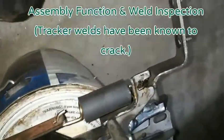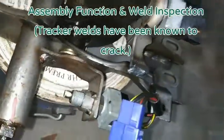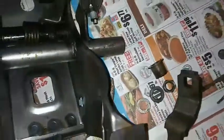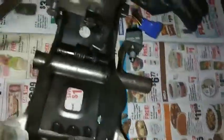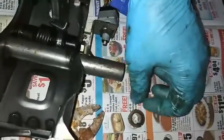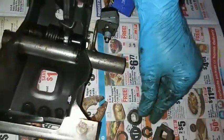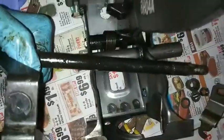I don't see any obvious cracks. To remove the clutch shaft out of the pedal assembly, I slowly moved it out of the slot from the threaded side. Be gentle because it's plastic or nylon. Once I got that out, the rod pulled right out and I just had to unhook the spring. Ready for inspection.